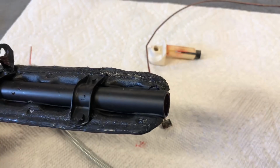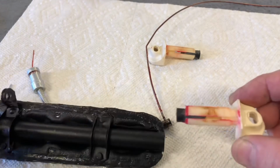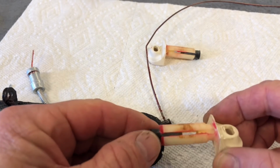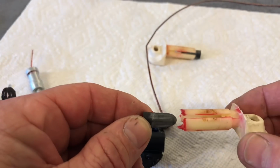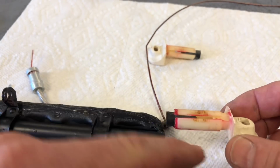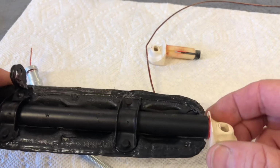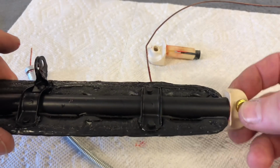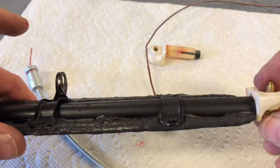So what happens is these dowel pins go in the end here, and it's got this rubber push-in expander. I'm just using it and stopping from our original marks on there. You can see where it used to be, and that keeps a spread on this and a predetermined amount of resistance as it turns in the flapper. And then our screws go in into the cowl, up into our dashboard there. And that's pretty much how that installs.